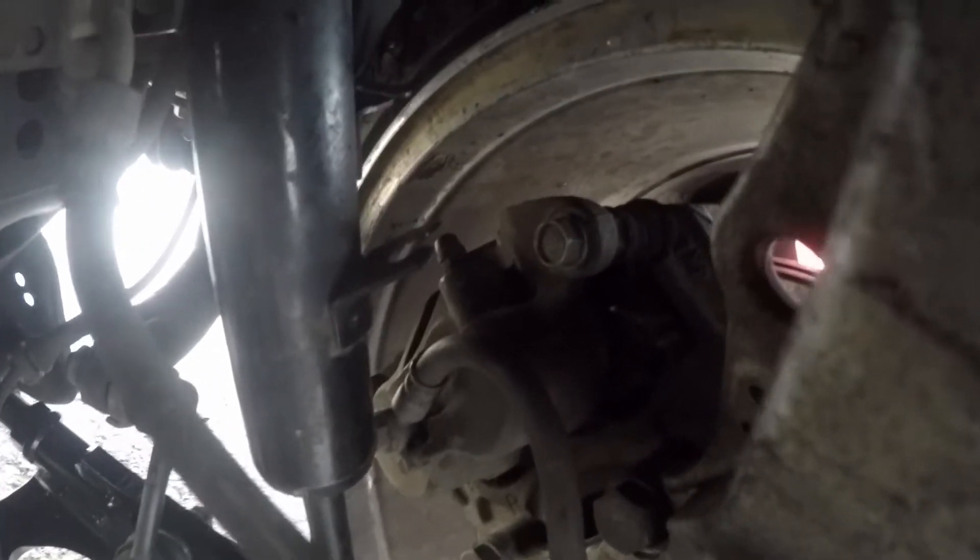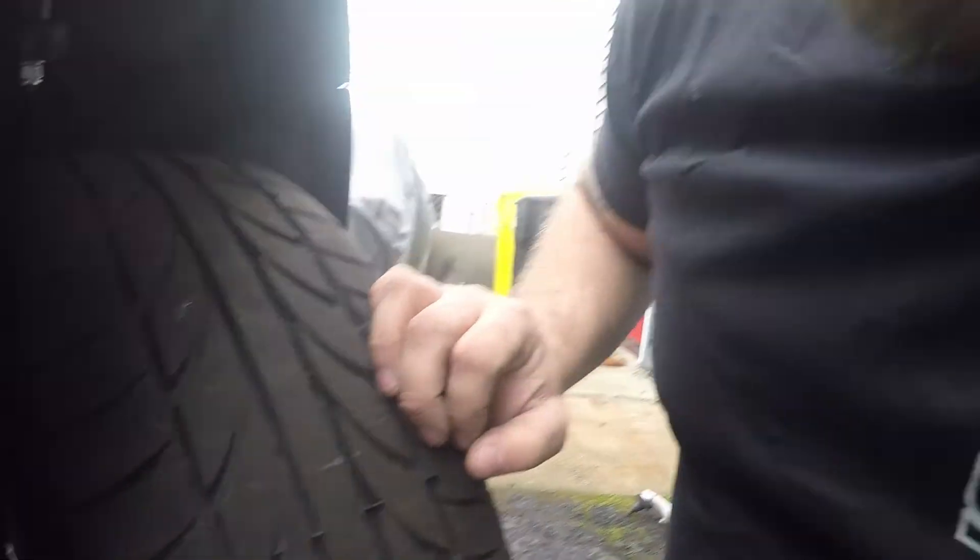What I'm hitting right now with the trailing wheel — the banjo bolt still hits the shock tower. We got a bunch more adjustment out of this because the lower control arms actually move that shock back about an inch, so we got a lot more angle out of it. Beyond that I'm not really sure what the solution is, aside from modified knuckles. That's probably going to be our limiting factor. Also, with the spacers on the wheels right now — I think those are 20 to 25mm spacers in the front.